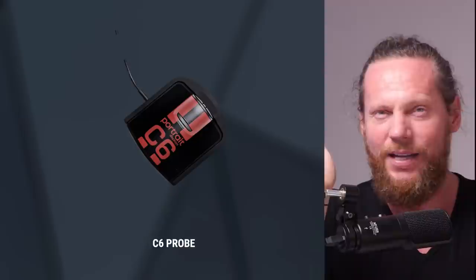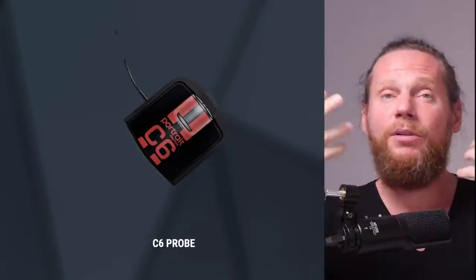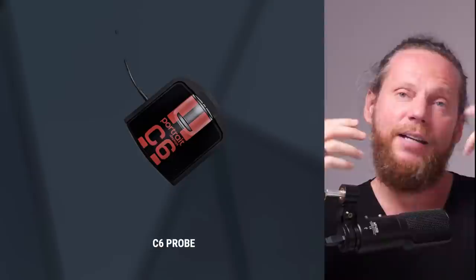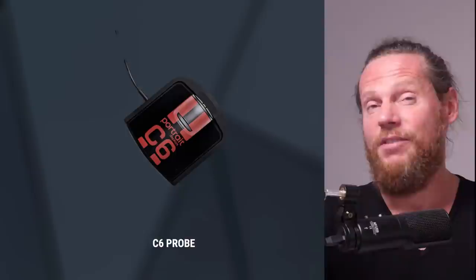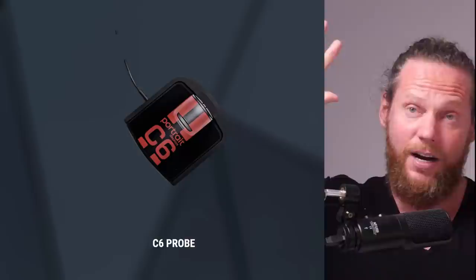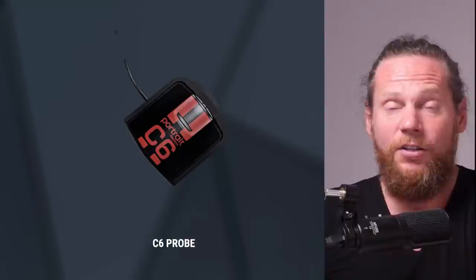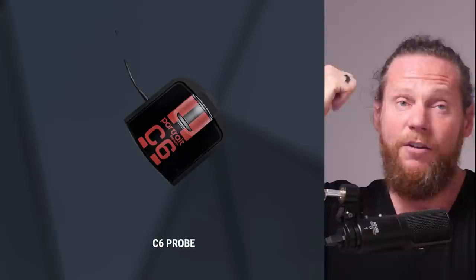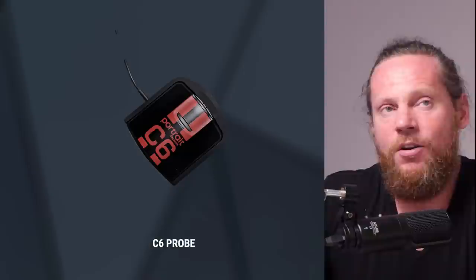We used to all use a box from AJA called Hi5-Plus that would take your SDI, convert it to HDMI, and embed the code — it cost a few hundred dollars. Now you can save that: you just tell the monitor to be in Rec. 2020 PQ and it stays in that mode. No need for any boxes or converters — go straight from your output HDMI into the monitor. Now position your C6 probe. I really think the C6 is the best value for money for HDR calibration — it's essentially a glorified i1 Display Pro, pre-calibrated by Calman, in a fancy box with a calibration certificate.